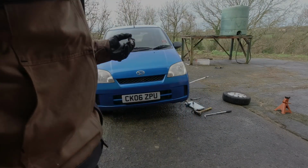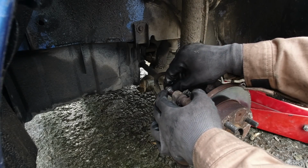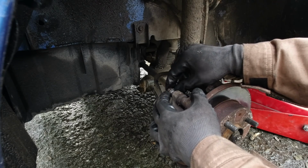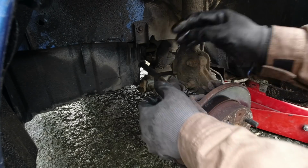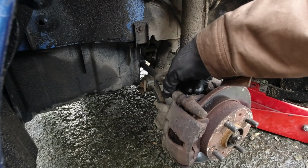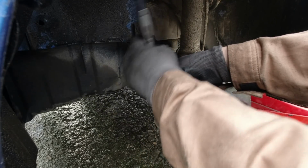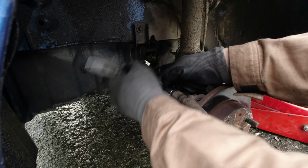because they are terrible. Well, I've used red caliper grease because I can't find my favourite Ceratec or whatever it is, the Mintec stuff. But yeah, I had to hammer that out, whereas now it seems to be sliding quite nicely. So we'll do that back in. 14mm. There we go. Feel a bit more confident this might actually work. And then we'll whip the bottom one out and do the same, I think.